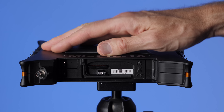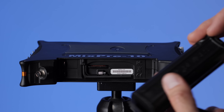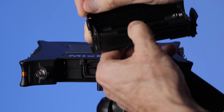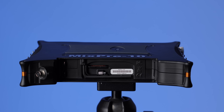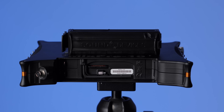There are a variety of ways you can power this. The default way — or the way you're supplied with the device itself — is a battery sled for eight AA batteries: four in here and another four up on the top. I really view this, from a realistic perspective, as a bridge battery. Unless you're doing a very short piece, like 15 minutes, I wouldn't recommend relying on these for longer shoots — basically anything over an hour. You may not even get a full hour depending on what you're doing.